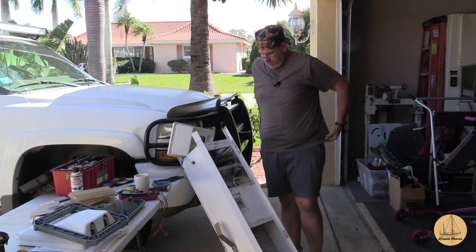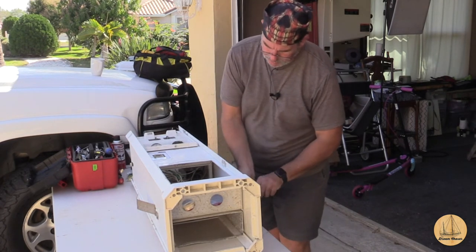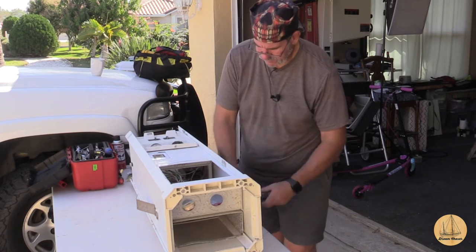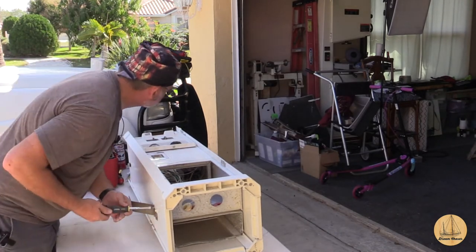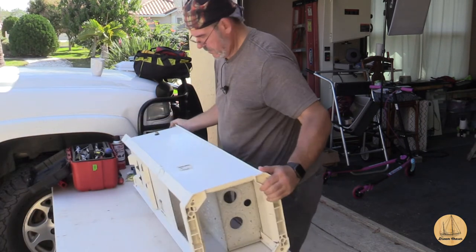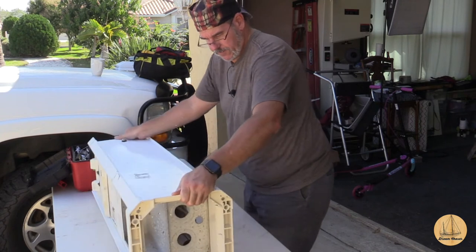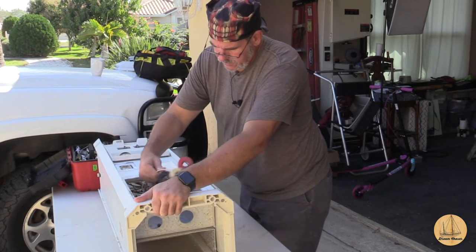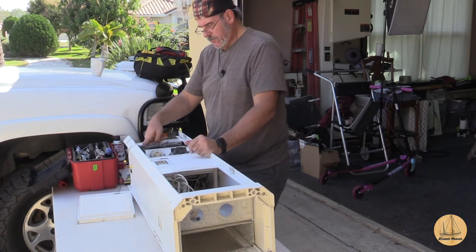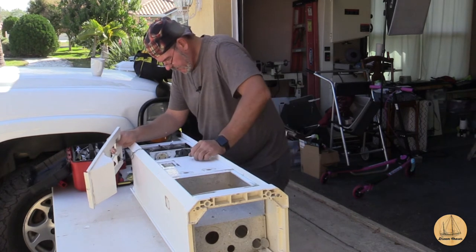Time to put this thing up on top of the table where I can take a good look at all the guts in an easier, more comfortable way. I've got it up on the table and I'm going to remove these hose and cord brackets. Looking inside — this side is just water, and all the electric goes in right here. My hot would come directly up from the load into the actual panel, my neutral goes right here, and my ground connects right here — ties them all in together. This makes sense.